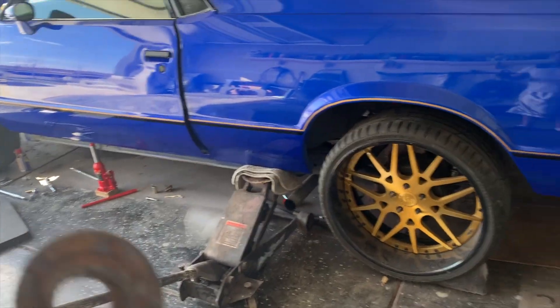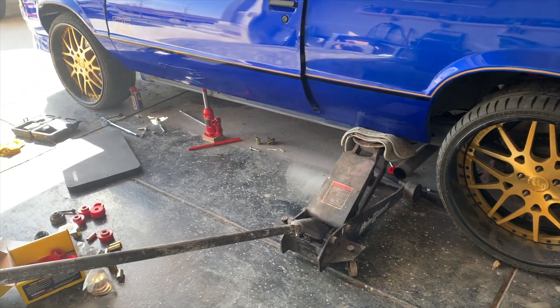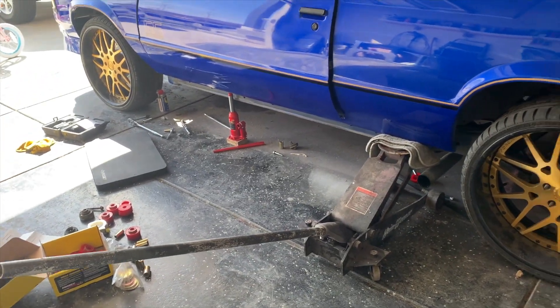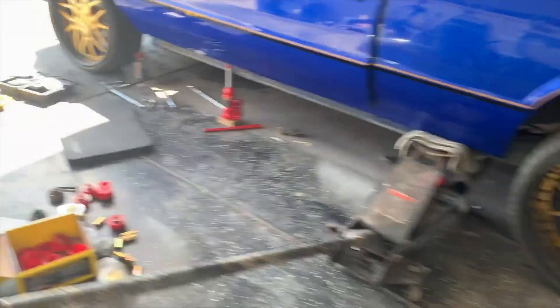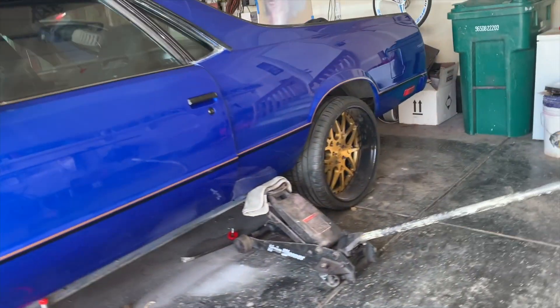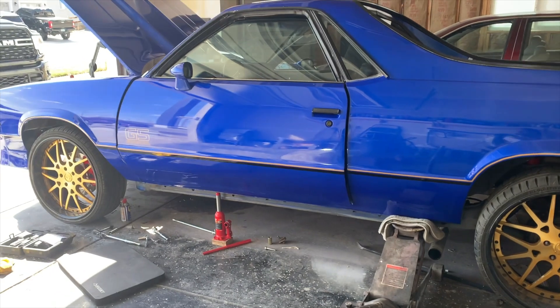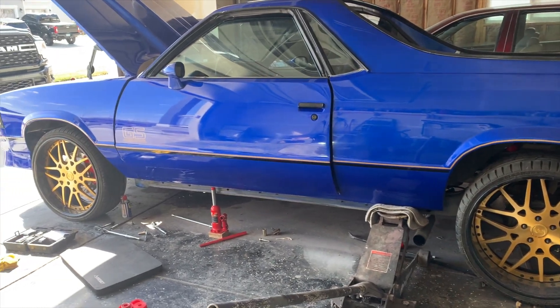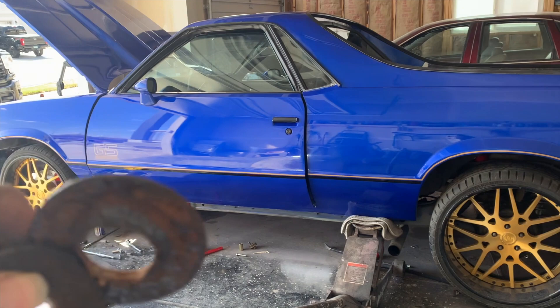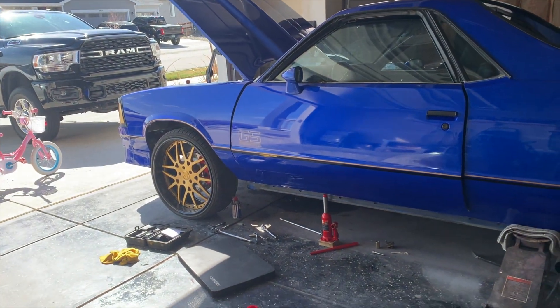I'm going to attack the transmission pan and roll it like that. After the car show — maybe the next day or next week — I'll attack the other side body bushing wise and we'll be in this thing for the summer. I got position number two in, and every body bushing on this side is in. I just need to get it bolted down. I'll start dropping the car a little bit to get it lined up and start getting all the bolts in.